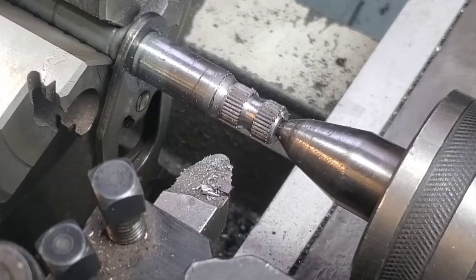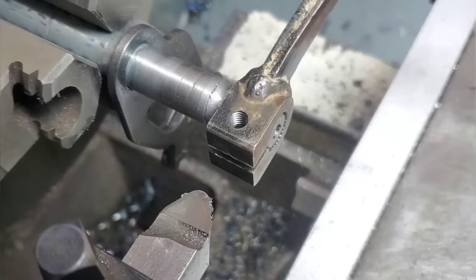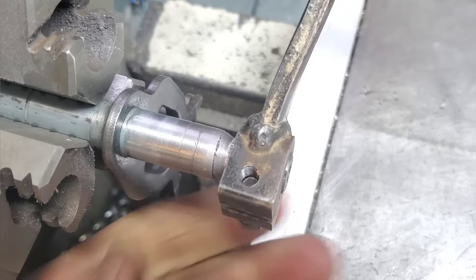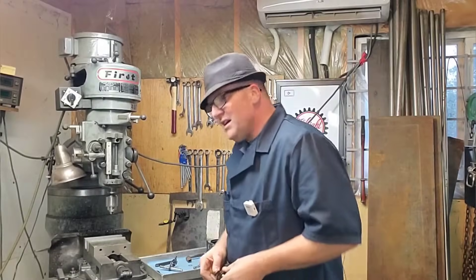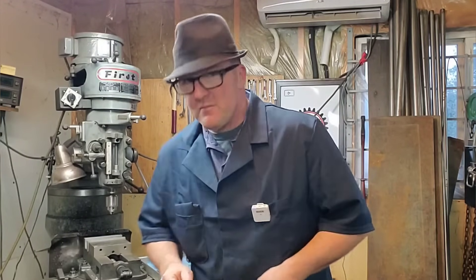There's only one more thing left to do — let's grab this shifter fork, polish this up, and put it on here to see how it fits. Keep in mind if you do one of these, you have to pry that shifter fork apart because it was clamped down on the other part that was ruined and smaller. I'm just going to lightly tap this a little bit further on here — there were a few little burrs holding me up, but in the end this bolt's going to go in just perfect. Man, this looks really good and I'm pretty stoked on how it worked out. I think this project turned out quite well.